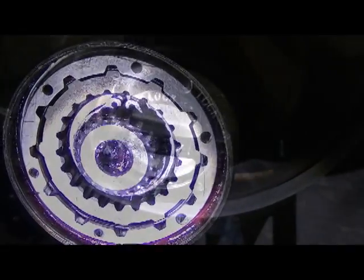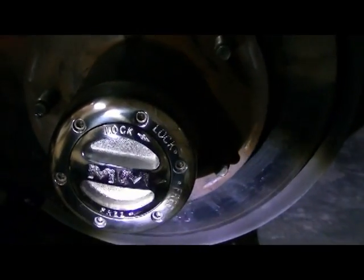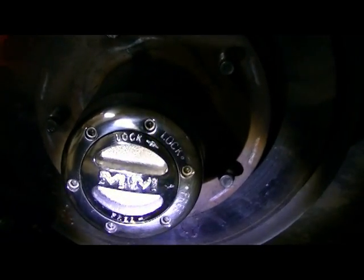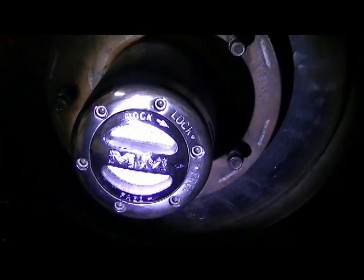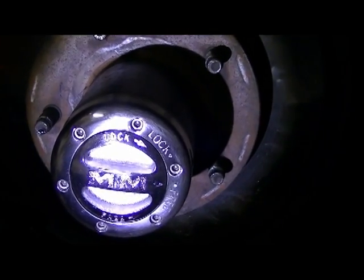Alright, so now we'll put the cover on, and put the screws on. Did it in a cross pattern, tightened it in a cross pattern. I think the instructions recommend 27 inch-pounds. Don't have a torque wrench, goes out low. Use the calibrated wrist. 27 inch-pounds isn't too much. Pretty snug. Just don't break them off.